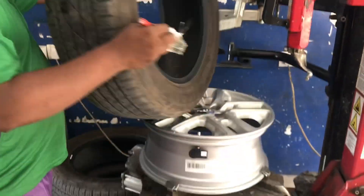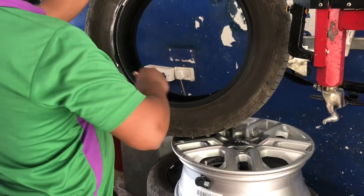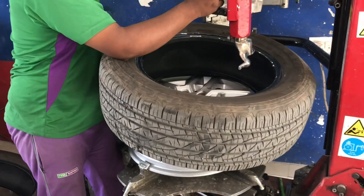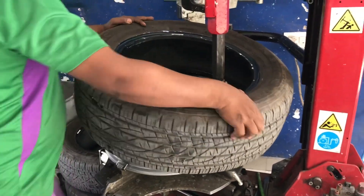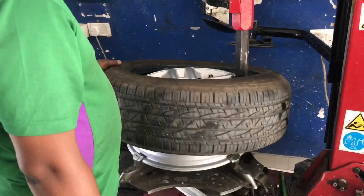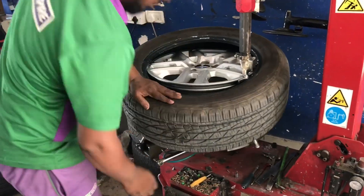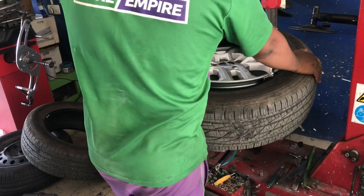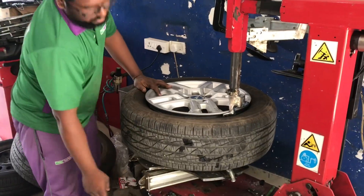You just need to work with the tire guys to make sure the respective sensors get installed in the respective wheels. When you configure a sensor as front left in the application, make sure that sensor actually goes into the front left wheel of the car. Do some chalk marking on all the wheels so you don't get confused about which sensor is in which tire.